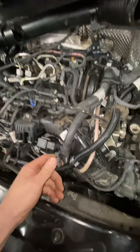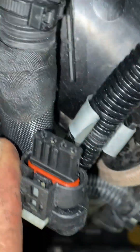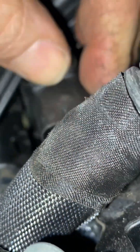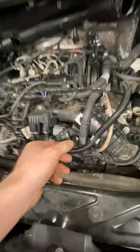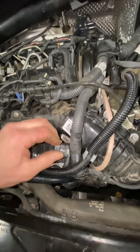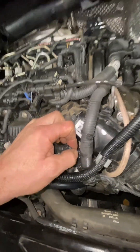On the B37, what usually goes wrong — and it's not an unusual fault — is the temperature sensor for the fuel system. There's a little temperature sensor and it's a pile of crap, it goes faulty. Last week I took the plug off and looked — it's usually full of diesel when they're faulty. Well, as you can see, it's absolutely bone dry. Just zoom in — you can see it there. Bone dry. That sensor is bone dry. Now, I suspect something because I don't know the history — the woman's just bought the vehicle.